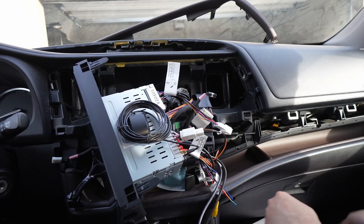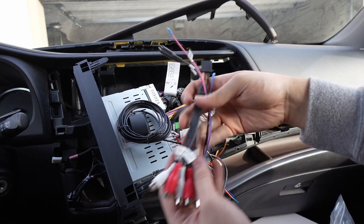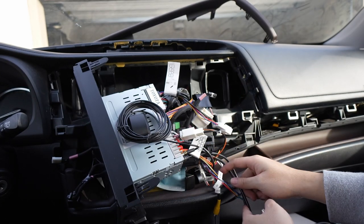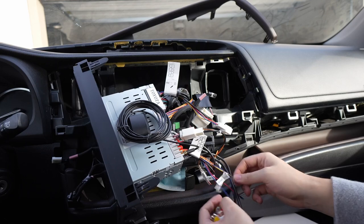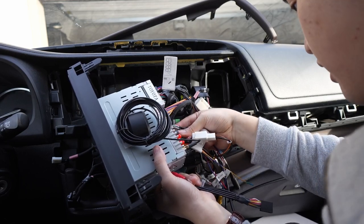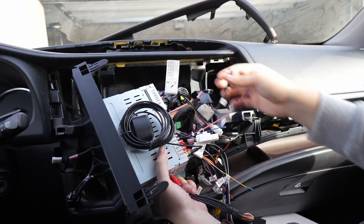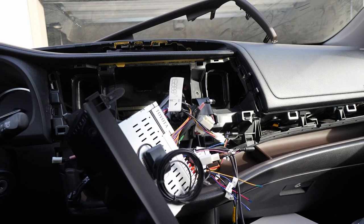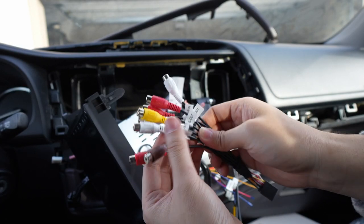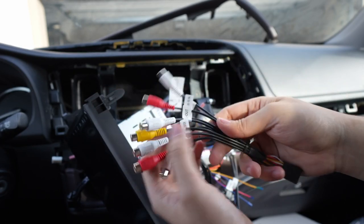Let's go through the other wires. We do have a Wi-Fi one — this one actually has the Wi-Fi antenna. The other one had amp controls and reverse. You want to plug this blue one in so you'll have a better Wi-Fi signal. If you have a better Wi-Fi signal, you're going to have a better CarPlay wireless solution. This microphone we're not going to use. The last wire is this one right here — it's if you want to have a subwoofer or use RCA jacks out.